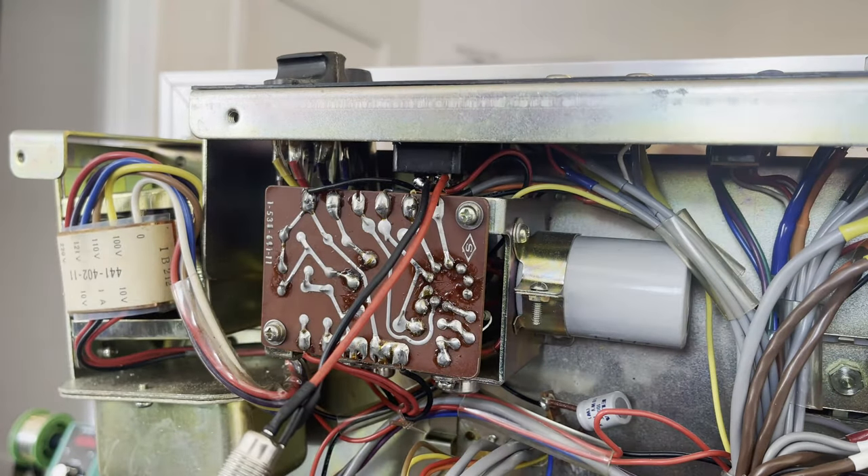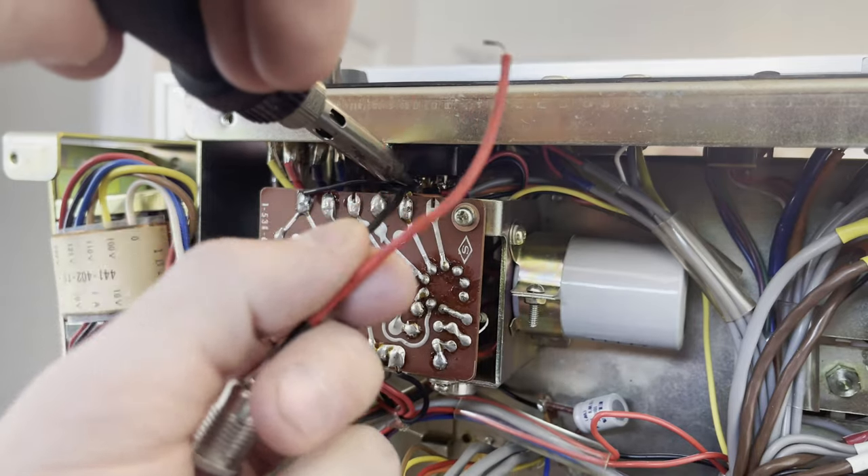Had to loosen it, put it up, and tighten it — got it fixed. You can still hear a little scraping noise, more noticeable in real life than in the video, and that's because the pulley was wrong. The belt doesn't go over the top of that left wheel — it now goes under it, which is what it's supposed to do. So I had to undo everything I had done and put that pulley on the correct way.